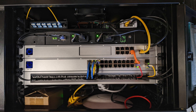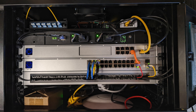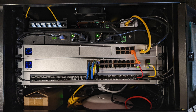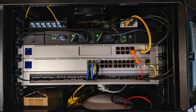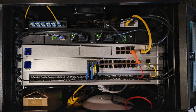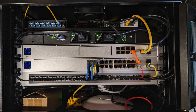Back in the office — the picture on screen is the network rack where Dishy is plugged into the network. The shelf at the top on the left side has a fiber patch panel connecting fiber to a different area on my property. The next device to the right is a Tycon POE injector, which allows you to inject whatever DC power you have external. The black cable goes from the green connector on that POE injector down to the green connector on the power supply below it, providing 54 volts of DC power to the four-pair POE injector and out to Dishy. On the back side of that POE injector is a data connector that plugs into the SFP port on the right side of the UDM Pro.